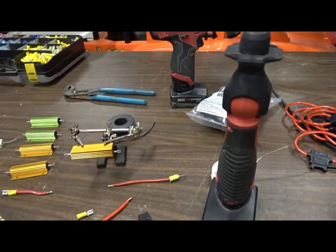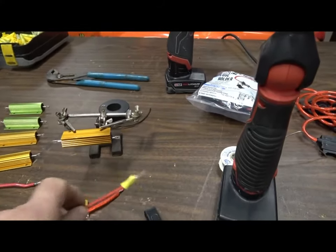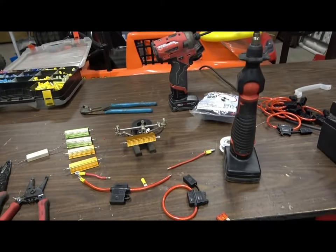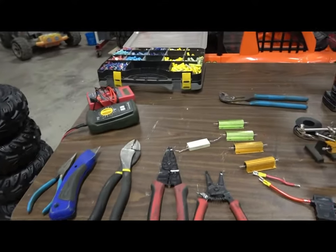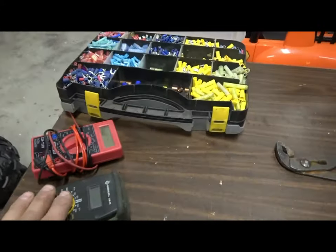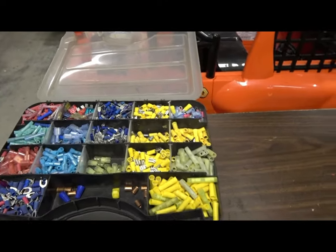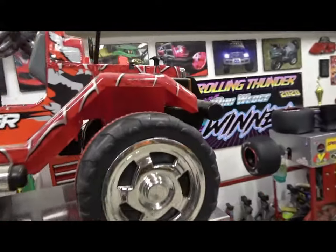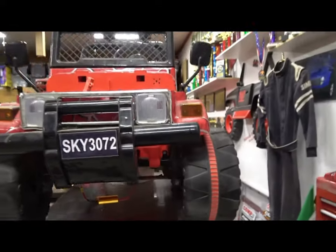These are the fuses I'll put in the description — pretty easy. Cut it in half, install your fuse. These are 40 amp fuses: one female crimp and one male crimp on the other end, wired inline into your harness. Power Wheels already did all the hard work. And here are some tools you'll need: wire crimpers, wire strippers, a volt meter, and a variety of crimp connectors.